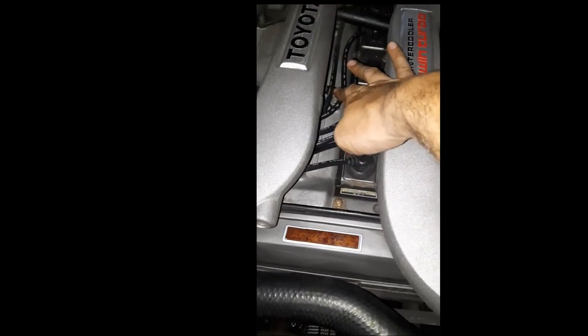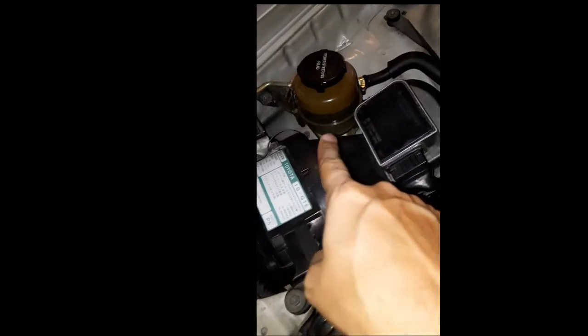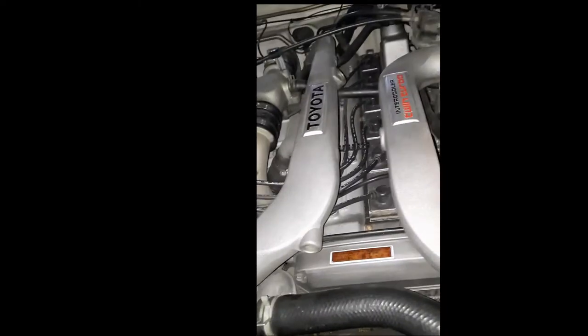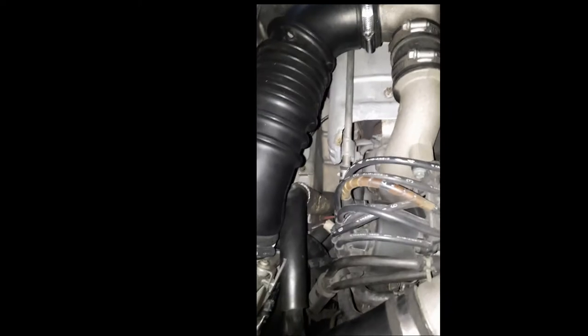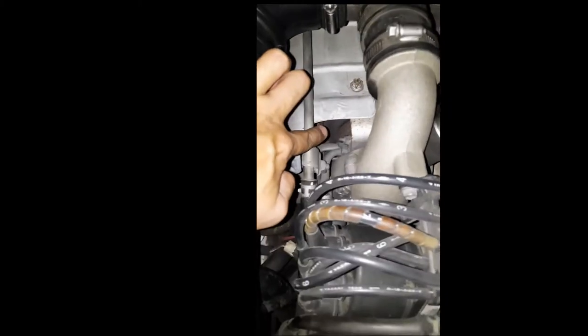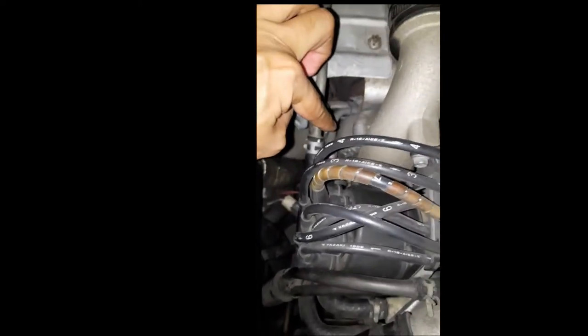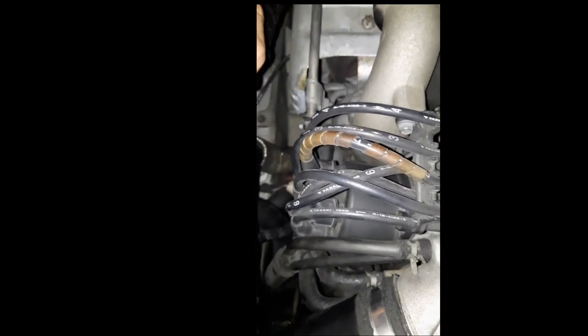And then you have shorter rubber hose life, shorter plastic life, shorter coil and plug life, or spark plug wires, distributor, and your power steering components, all your brake booster and so on and so forth. So all these things get a shorter life because of heat soak. And the hottest component over here is the turbo. I've measured 133 degrees Celsius after shut off on the hot side of the turbo, right? So the cold side is about 100 Celsius. So there's some difference over there.